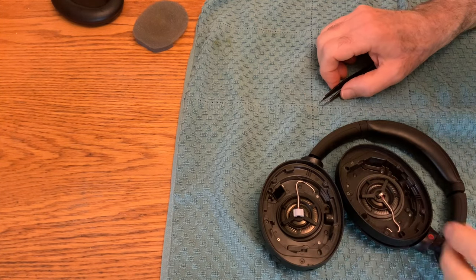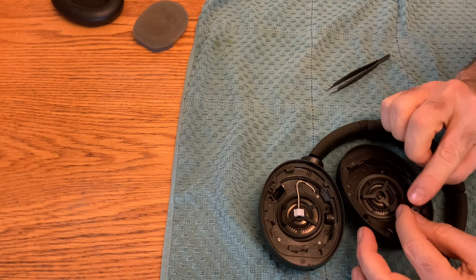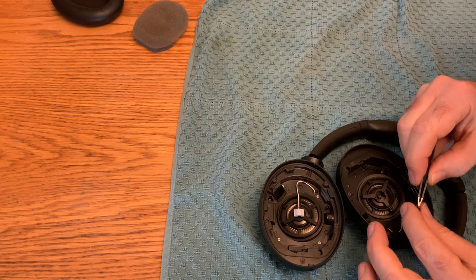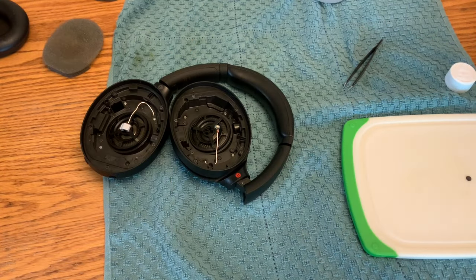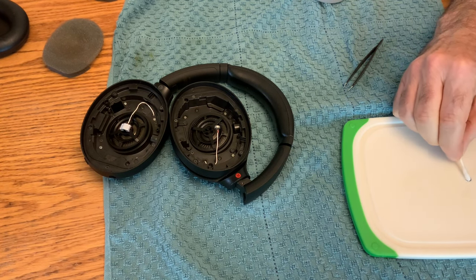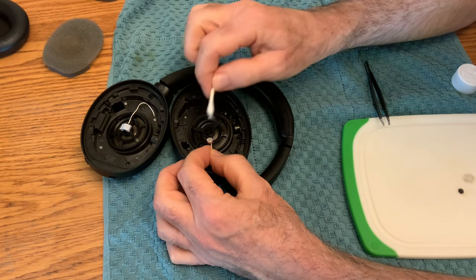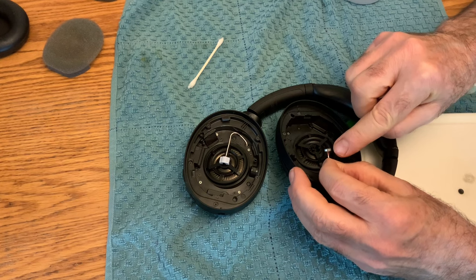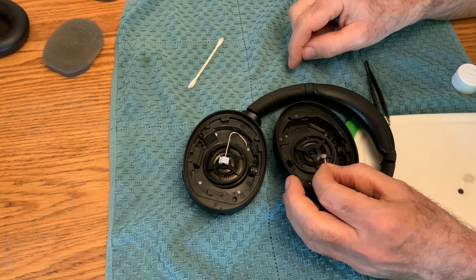When the rubber cover comes off, the microphone is in there, just pressed in place — pull it out carefully; it has a little rubber cover on it. I'm going to try to get that cover off with tweezers. When I look at the microphone up close it looks like there might be something on it. I'll use some rubbing alcohol on a little swab to clean it and also clean the microphone cavity. Other people suggest taking a toothpick to gently separate the little wires to make sure they're not touching.